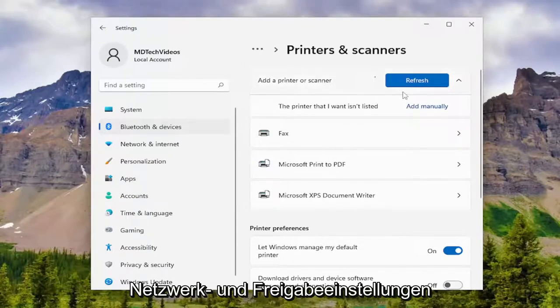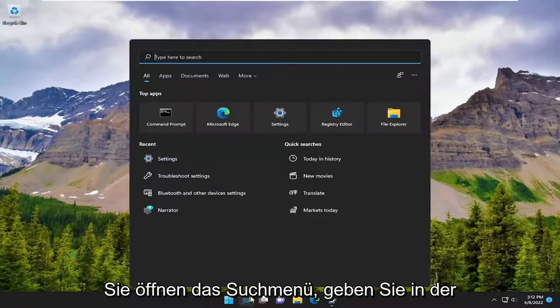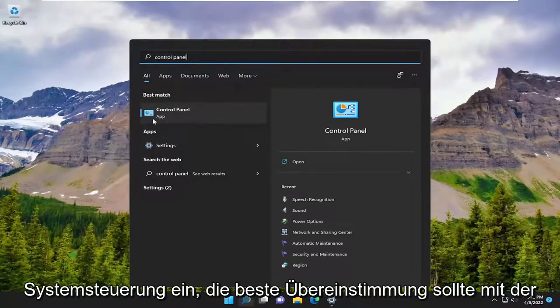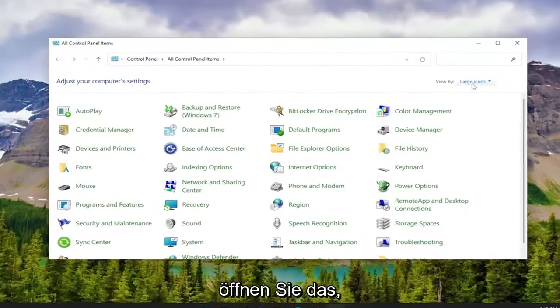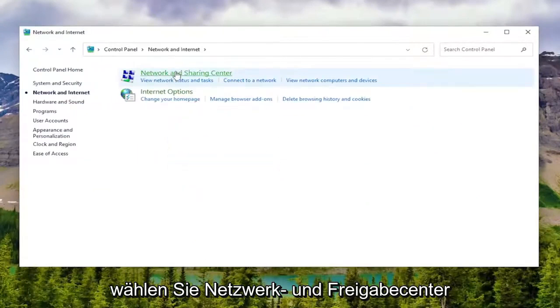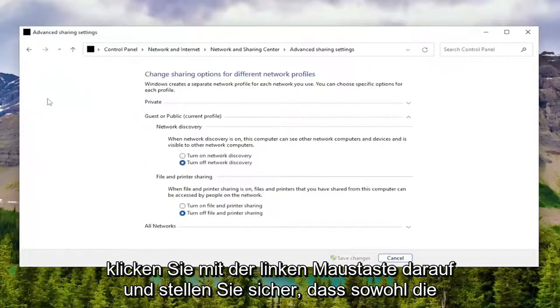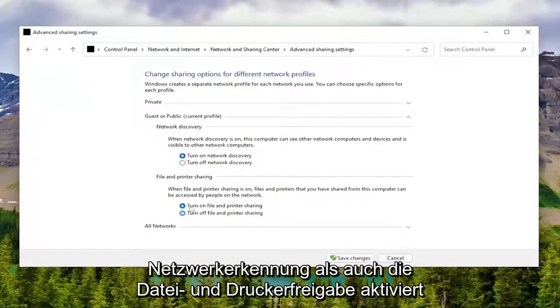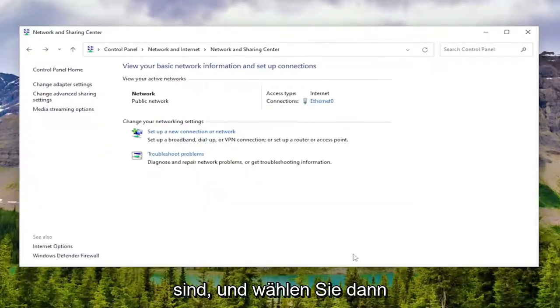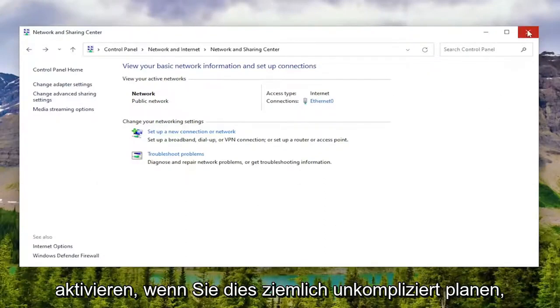You may also want to make sure your network and sharing settings are enabled on Windows as well. Minimize out of here, open up the search menu, type in Control Panel, and open that up. Set your view to Category view and select Network and Internet, then select Network and Sharing Center. Where it says Change Advanced Sharing Settings on the left side, click on that and make sure Network Discovery and File and Printer Sharing are both turned on, then select Save Changes. That would apply if you're using a wireless printer and trying to share your printer with other computers on your network — definitely something I'd recommend enabling if you plan on doing so.